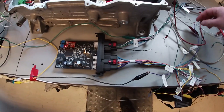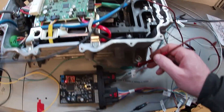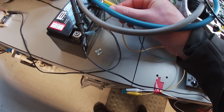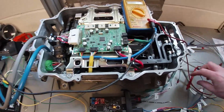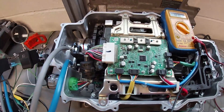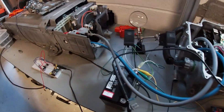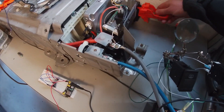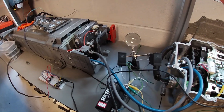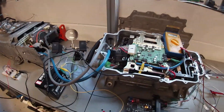At the moment the switched live for the inverter is at 0 volts until we have ignition — so this is our ignition and it's going to light up the inverter. There we go, so we've got our 12 volts, the board is alive. Next thing to do is add in the safety disconnect and give it the pre-charge. Pre-charge is coming in to the board now, then you can go full — so that's good, it's full 220 volts.